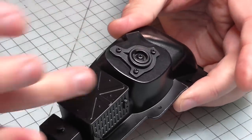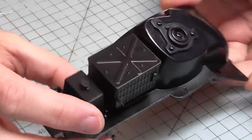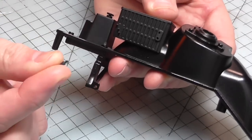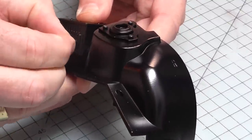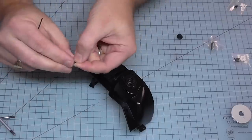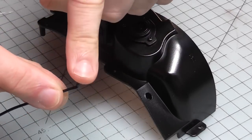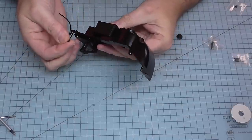A lot of people are modifying some of these things — things like the washer reservoir bottle are all black, and I'm sure there's going to be more color underneath the engine. In the control box we've got two small holes. On the bottom hole we attach this tiny nipple, and I make sure that's pushed all the way in because we don't want to lose it. The other fitting is bent at a right angle, and I have a pipe which is going to go into the top hole. That pipe has a semicircular pattern on the end so it can only go in one way — try not to force it.